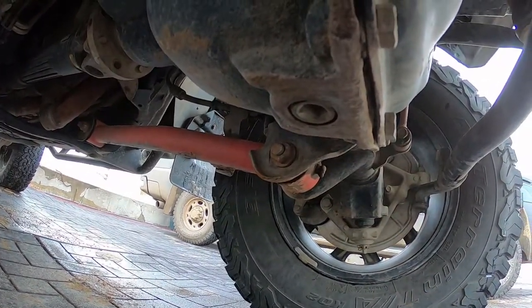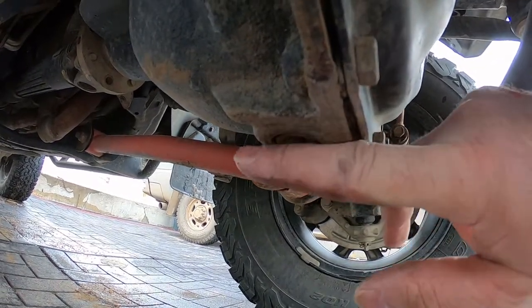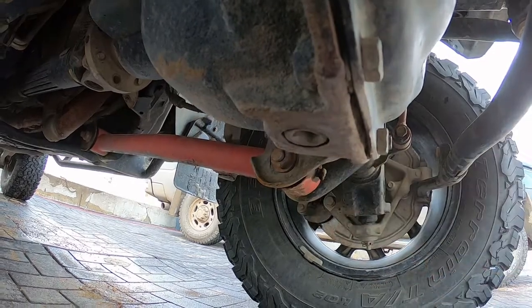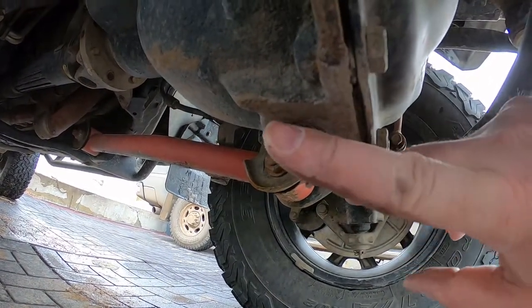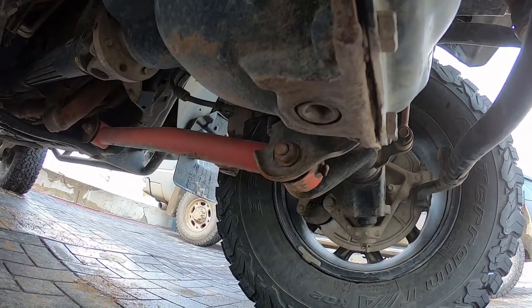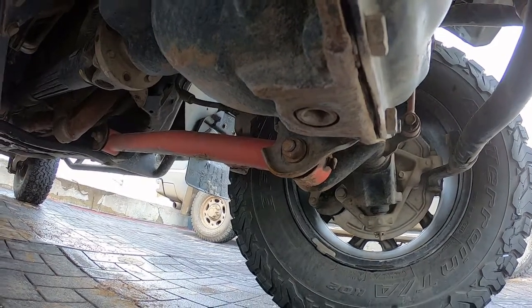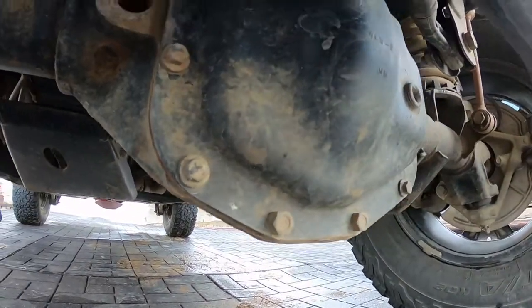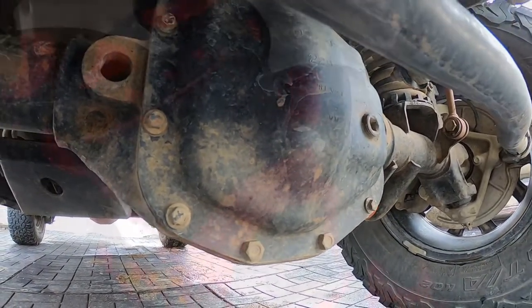So if you can't afford the skid plates right away, I would definitely look at doing that, so that nut doesn't get smashed out, and you can put a couple touches of weld on that too to secure it if you're never going to use it, which I don't know how often you'd use it. Most of the time you pull your front cover anyway to do an oil service. So let's get these bolts off.